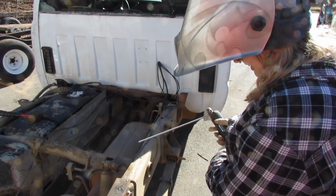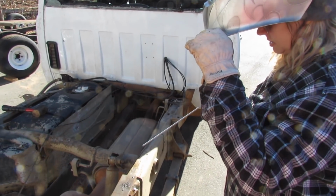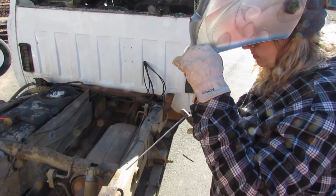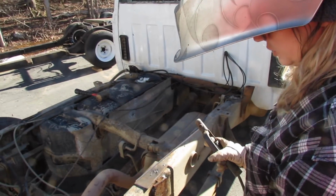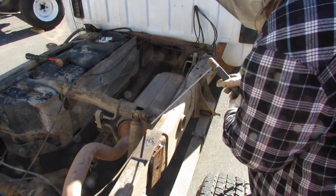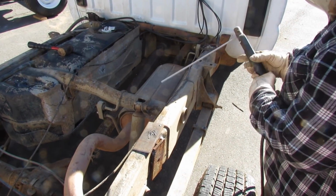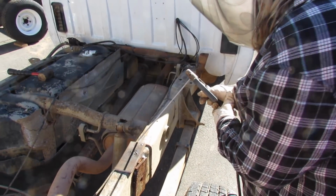First time ever. Remember, you got to kind of drag the rod and let it start arcing, and once it starts arcing, start welding. Okay, but here's too much of a gap. You ain't gonna weld that side. Just weld here, just the ends. And here. Yeah, that's it. Go for it. Is there a trigger? No trigger. You just, when it makes contact, that's when it goes.